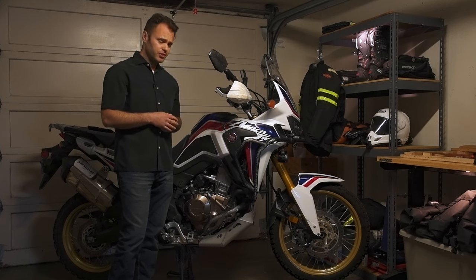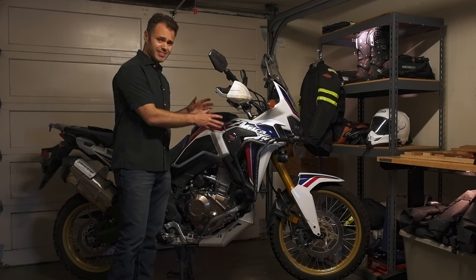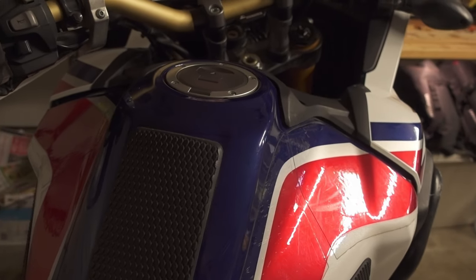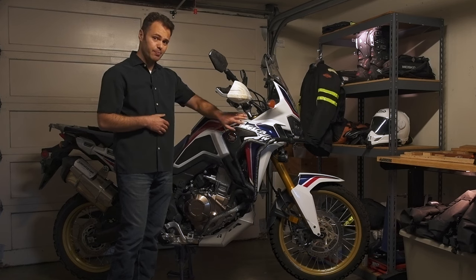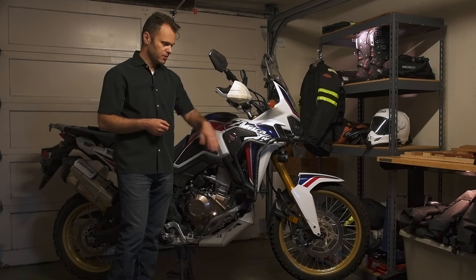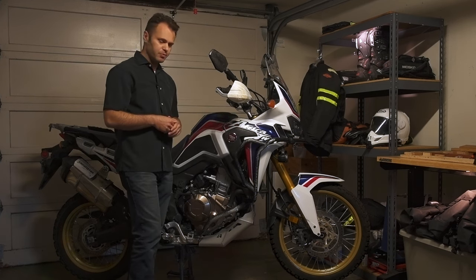For the uppers — I really wasn't sure initially if I wanted them. Some bikes don't need them; the Ténéré 700 for example is a narrow bike and when it falls the tank never hits the ground. But the Africa Twin is a voluptuous gal — the tank really sticks out. As you can see from all the rash on these uppers, this part of the bike makes contact with the ground, and I'm pretty confident that if these weren't here, at minimum the plastics, possibly the tank and possibly the radiator would have taken impact on some of those falls. These uppers provide that protection. They're not quite as beefy as the lowers but they do fine — there's absolutely no play after all these falls, and they've done their job.